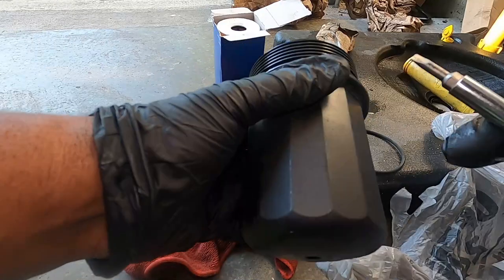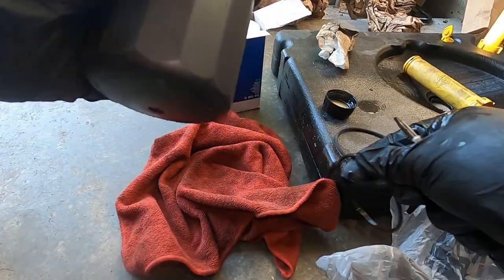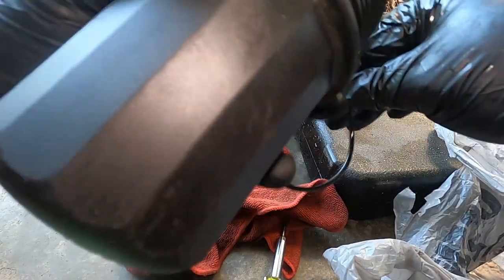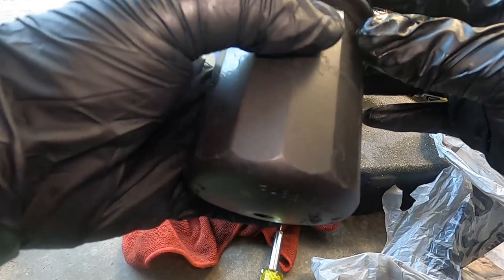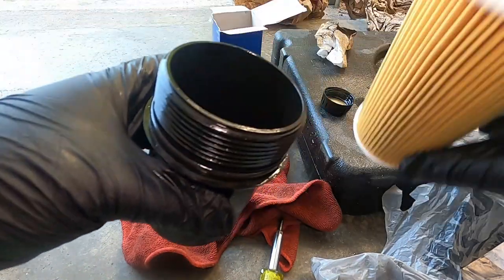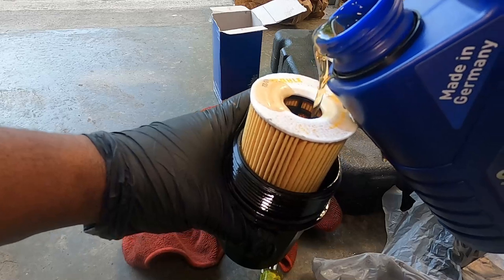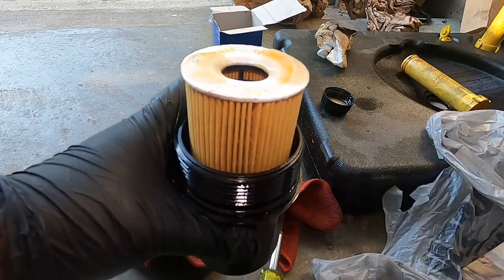Now that we've cleaned up the oil filter housing, we want to go ahead and remove the old gasket. You can use a small screwdriver to remove it like that. This is the old one and this is the new one. Before we put the new one in, we want to use a little bit of new oil to rub it, just so that it doesn't break when we place it back. Then we want to place it back in the same groove — and there you go. Once we have it like that, we can take the new filter. I remember the marking was on top. So I want to go ahead and place it, then put a little bit of new oil inside here, just a tiny bit, so that on the first start you have some oil. Then after that we want to mount everything back and torque this to 17 foot pounds of torque.